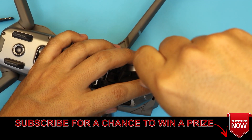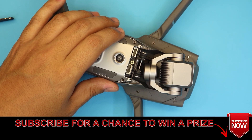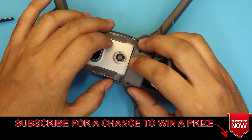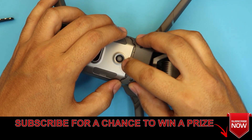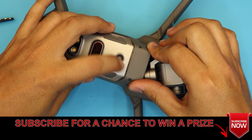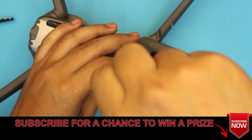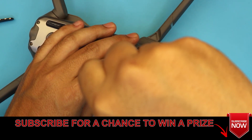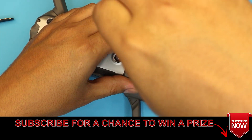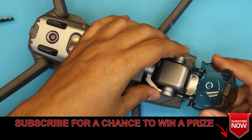If you guys have any questions, ask me in the comments and I'll try to answer them as soon as I can. Appreciate if you click that like button. Now that we have the gimbal in place, go ahead and put the plastic cover on. Make sure the clips go in first — put one side of the clips in, push it down, then put the other ones in. It should go in easy. Slide it towards the sensor, make sure it sits flush, and put the last two screws in. That's all about it — this is how you clean and maintain your drone. Hope you liked it, click that thumbs up, and if you have requests or questions ask in the comments. Thank you for watching — see you in the next video!